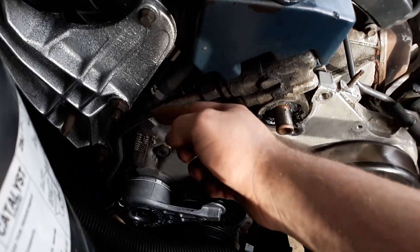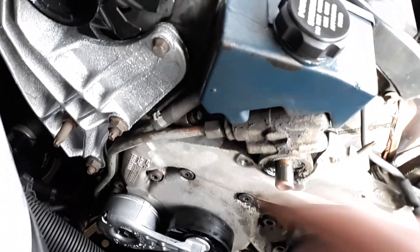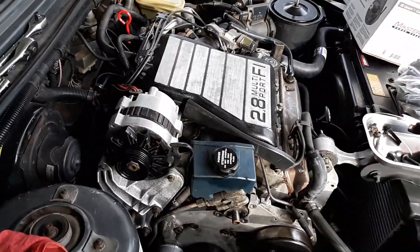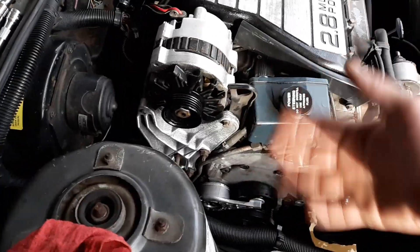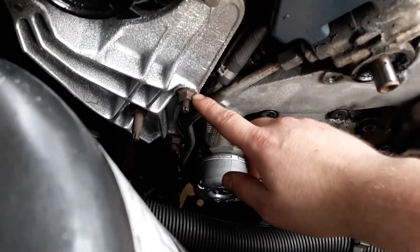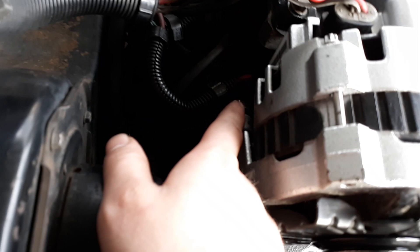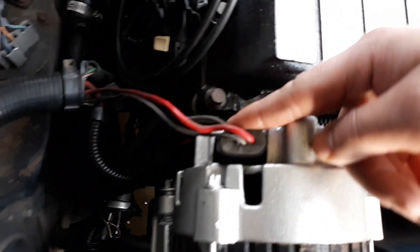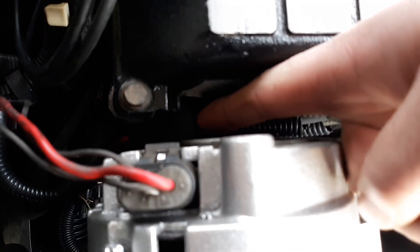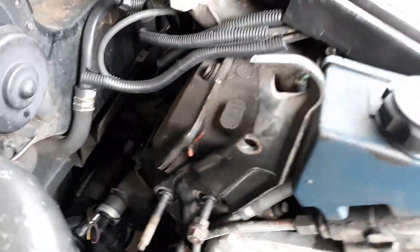I took a flat head and moved the line over, but there's still a section that has to come up above the bracket and it can't do that with the alternator in the way. So you need to undo the battery, take the alternator off the bracket, and then the power steering pump can come out. The alternator bracket uses three 15-millimeter nuts, a 13-millimeter, and a 10-millimeter bolt on the positive battery side.